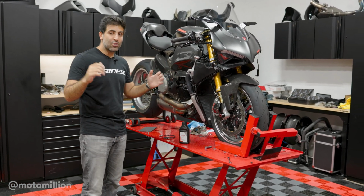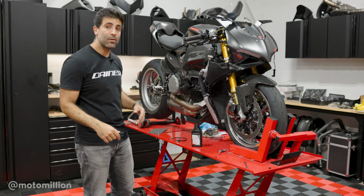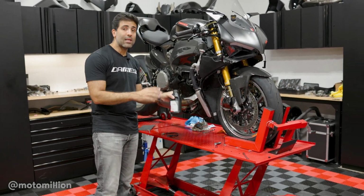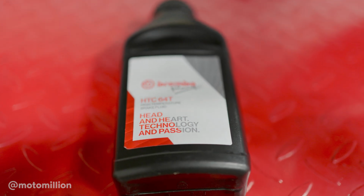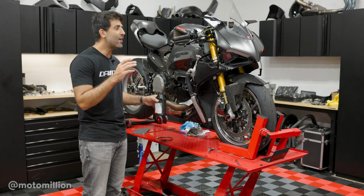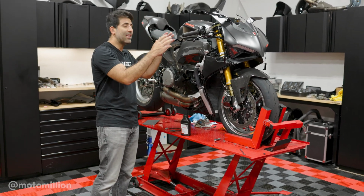So I know if I don't mention the brake fluid, you guys are going to say in the comments below what kind of brake fluid we use. We use the HTC 64T from Brembo because it's the least compressible brake fluid. We'll go into details of these things when we film our brake upgrade guide for a Panigale V2.